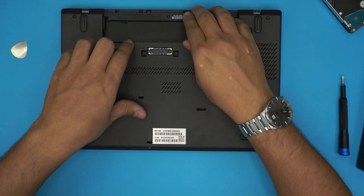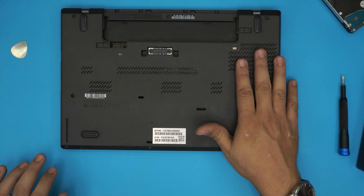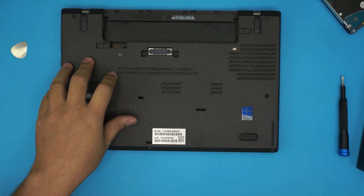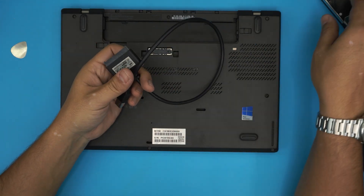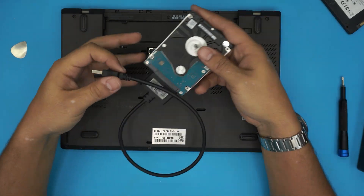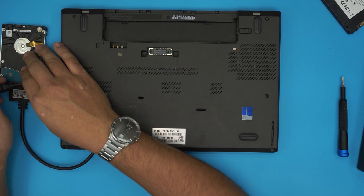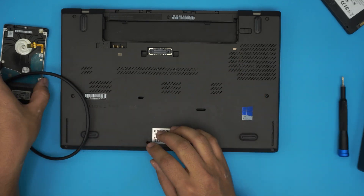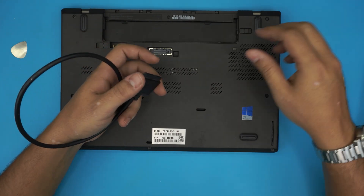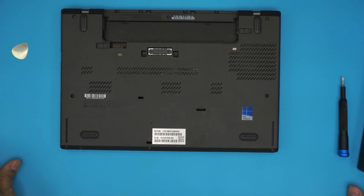Once you change the hard drive you will need to install a new operating system on your new drive. If you don't want to install from scratch, you can clone your main hard drive to the new one — there's a free program linked in the description. Before you open the laptop, grab a SATA to USB adapter, connect your new drive via USB to your computer, open the program, and it will clone your existing drive to the new one. Alternatively, you can do a fresh install using a USB thumb drive by downloading the OS from the Microsoft website — the link is in the description.